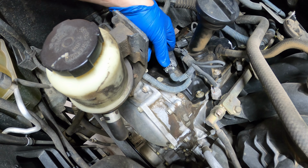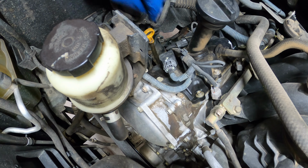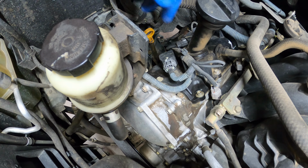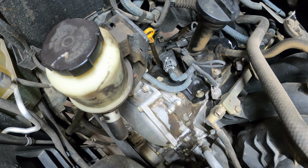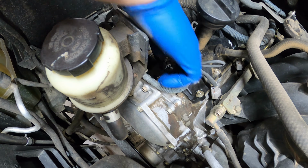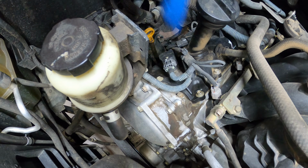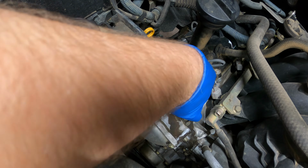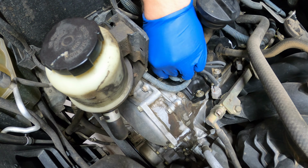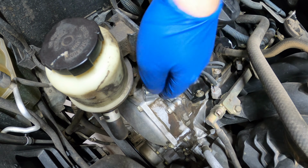All right, so this is one of your spark plugs. I don't know which. It says 7 on it, but I think that's just a quality check mark, which means these are original. So all you're going to do is grab this little gray tab here, depress it, and pull off, however you can do that, without getting in the way of the camera. Lucky you, you're not using a camera. Holy crap, I just drove for a half hour. This is hot. It's hot stuff, man. Oh, wiggle, wiggle, boom. All right, get your connector off.